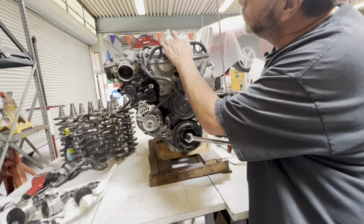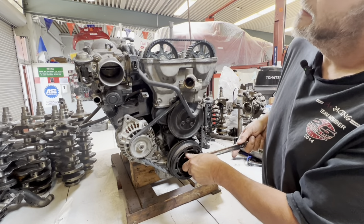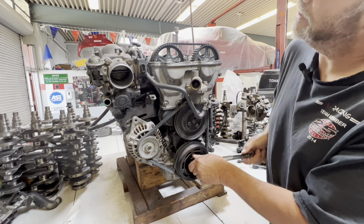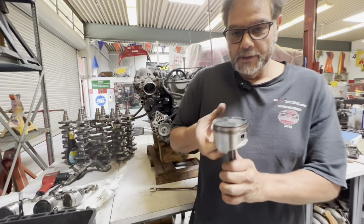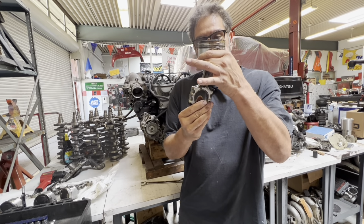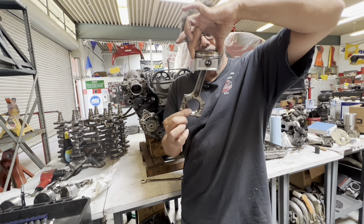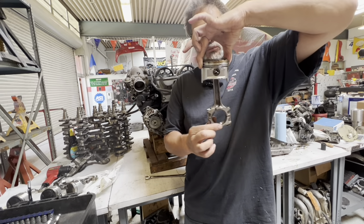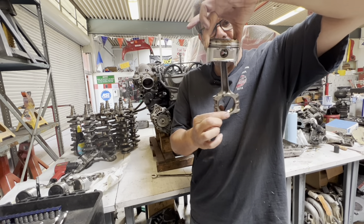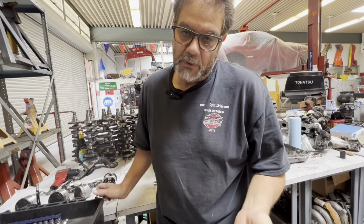Watch this — I'm going to move this with a wrench. You can see these gears are moving back and forth. I'm moving one tooth and you can't see that moving. So I could be off by as much as a tooth. Here's the reason why: the piston is on its way up to top dead center, and once it gets all the way up, this rod has to switch from going up on one side to going down on the other. There's a momentary dead spot right at top dead center where you can't accurately judge position.